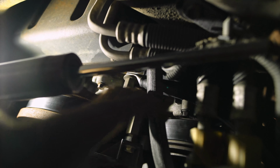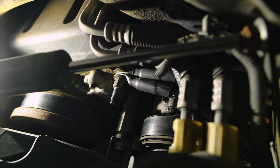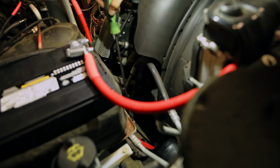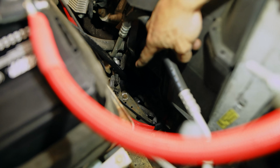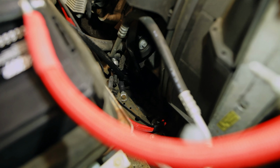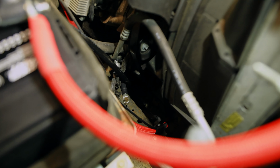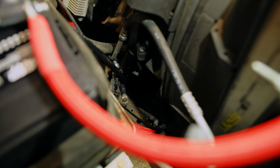So now we've got both of those on there and started. Let's see, they're kind of just both sandwiched in like that. And then now I'm gonna go connect it loosely on the frame side from up top. So here's where the other end of the smaller cable went. The same routing location as the factory. All right, so we got the 13 over there. That's the other half of the smaller ground. I'm gonna go into there and tighten the 15 that hold both of the grounds on, and then I'll also show you how to install the bracket for the starter feed.